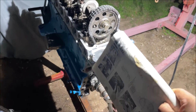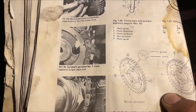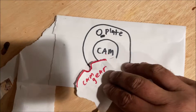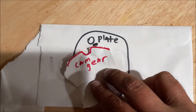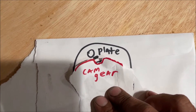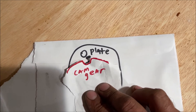On this engine that was rebuilt, our groove is to the right of the notch. If you're working on an engine with it all apart, you're going to have to rotate your engine at least one revolution to the right to pull the slack out of that chain. If your mark on your cam gear is to the left of the notch in the hold-down plate, then you want to make the one-two-three adjustment. As we approach zero on the balancer, my cam lined up with the mark about right there. This notch in the cam gear indicates that our chain is new or in good shape - the book shows the notch over to the left meaning the chain is stretched.